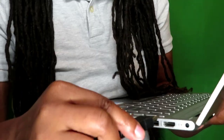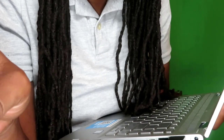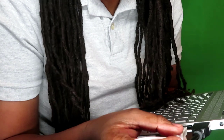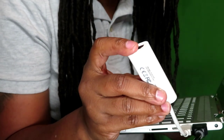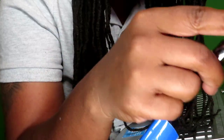Now for the physical connections: hook up the HDMI cord into your laptop and the other end into monitor number one — that's already hooked up. Then take your USB-to-HDMI adapter and plug the USB end into the side of your laptop. Next, plug an HDMI cord into the adapter's HDMI port, and put the other end of that cord into monitor number two.